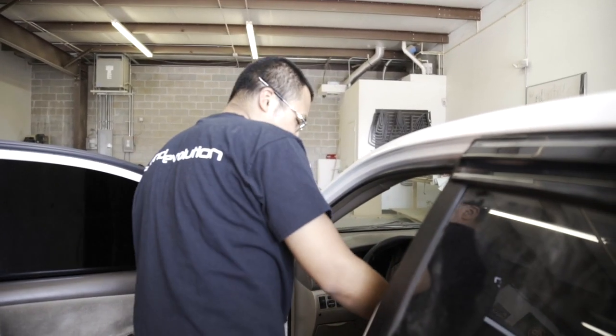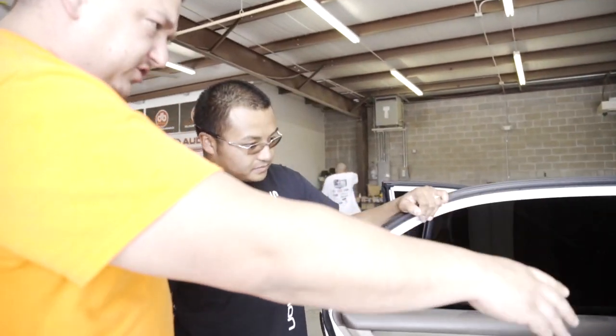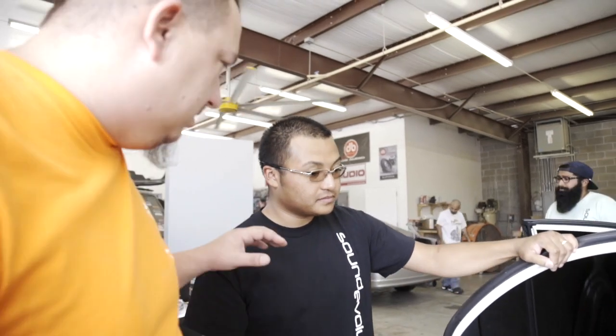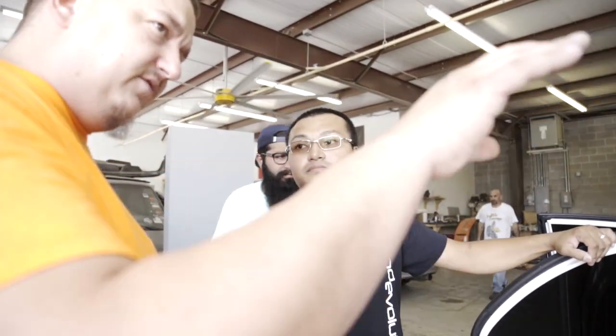So that's what we got. We got the box in there, and the box is anchored down. Hold on, before you get in, check this out. Everything's bracketed down. Eventually, we'll go ahead and wing it off and put a roof on it, and we'll totally wall the car. You're gonna wanna wall the car because the entire back of the roof is moving a good inch and a half.